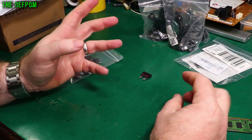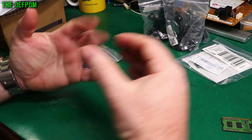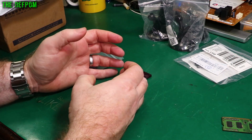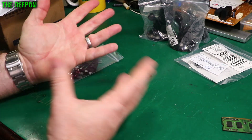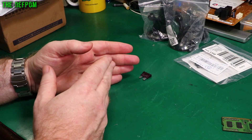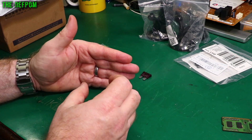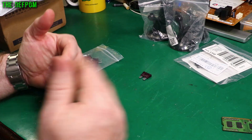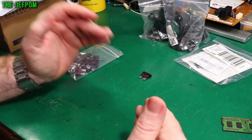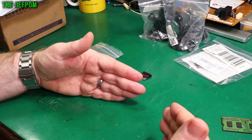It's got two states. In the motorhome I've got two systems: the vehicle battery which runs the engine and vehicle stuff, and the house battery which runs all the accessories like the inverter. What I've got is a big relay linking the two together in two different states. In one state — when the vehicle is parked and the engine is off — I've got a trickle charge circuit running from the house battery to the vehicle battery. I've got a big 5-amp Schottky diode in there and a resistor to limit the current to about an amp, so it trickle-charges the main battery and keeps it in a decent state even if the vehicle is parked for three months.